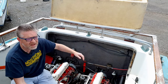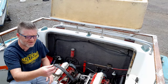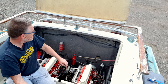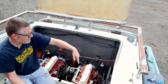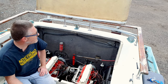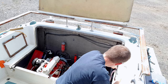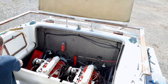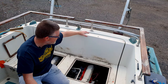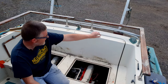It's not exactly a seal, it's just a rotten old bit of foam — latex foam, rubber foam — which is gone and shot and awful and probably quite carcinogenic. So I've scraped and given a quick chemical wash around the sill of the engine cowling. I will stick the new foam seal tape around and hopefully that will be a much more comfortable, clean bit. Unfortunately it's not quite thick enough so there is still quite a bit of play. I think I want to get some rubber edging that will sit on the outside edge of the cowling.